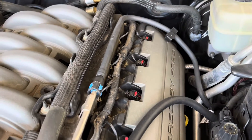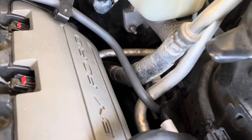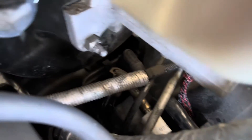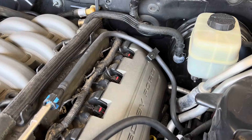Now we're back on the top side. You can do the fuel rail line one of two ways: find a factory line, which is obsolete — you can't get it new — but it will bolt in and connects down below the master cylinder. You can see this 90-degree fitting, which is very difficult to get to, especially if you have an engine in the way. I installed it when the engine was out. Or you can pay a little extra and we'll have a line made for you in our kit. I installed this in less than an hour and literally needed no extra hardware besides what's shown — a lot of factory hardware was reused.